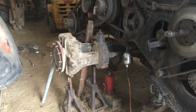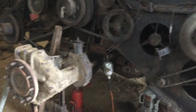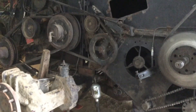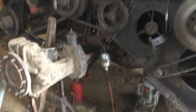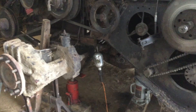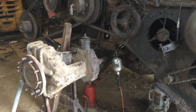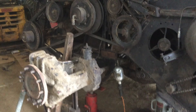When you're working on a clutch there are a couple of different ways to do it. You either remove the transmission, which is held in by four bolts — maybe three-quarter inch and two three-quarter inch — and if you've got a hard surface to work on you're okay. But if you're out in the middle of nowhere or in a cold winter shed with a dirt floor, you've got to figure out how to get the thing back up in there, and they weigh several hundred pounds.